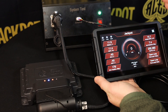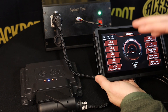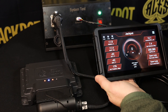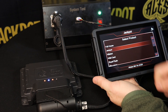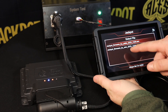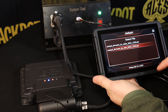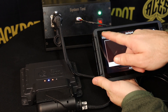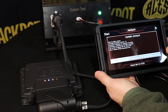Just like I mentioned before, it's not always necessary to upgrade your ECU, and doing so will wipe your learned data stored on it. So it's always a wise idea to back up your tune first before any handheld and ECU update. We're going to go into settings, select ECU upgrade, select the Jackpot system, and double-tap to go to the next screen. Hit upgrade ECU — depending on your version, this one is a drive-by-wire version, but if you have the drive-by-cable version you'll select that one. We select drive-by-wire, double-tap, confirm we're good with proceeding, hit OK, then hit start in the top left corner. It's going to start updating the Jackpot app data and then download our calibration data.